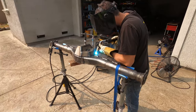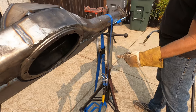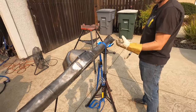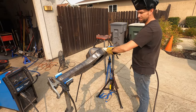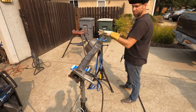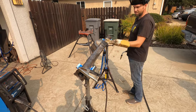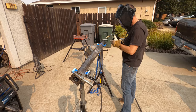Because of all the weight on the axle with the truss and now that protection, we stuck a ratchet strap on here, cinched it down, put some little padding on there, and then that holds it into place so we were able to spin it around. All the counterweight won't flip it one way or another. So now it holds it into place and I can weld the right side up. Genius.